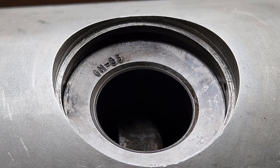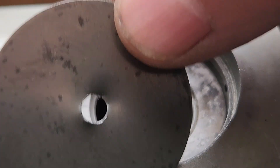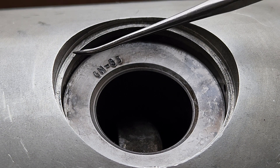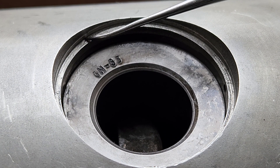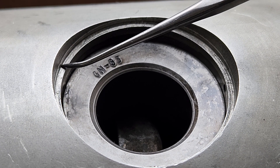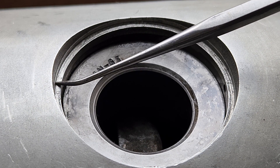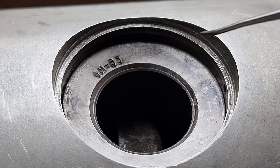Here's a close-up of the machining on the side where the piston pin retainers go — we'll try to reuse these pistons. We drilled them and pulled them out. You can see there are two machined areas: the area where the retainer seats, then a little ledge. Where ours were pushed in they were pretty clean, though we had some galling on some of them. You could tell that when they were pushed in at the factory, the extra material laid right in behind it. I'm going to document what we did in case it works.